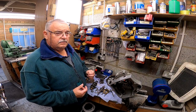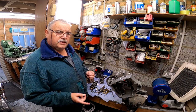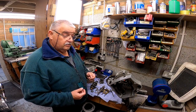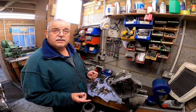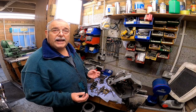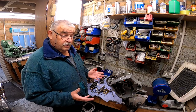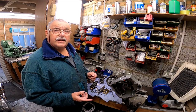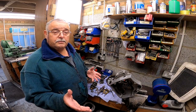This was on an old Triumph T150, that old thing behind me, and the root cause of it all in the end was the shock absorber rubbers had become swollen with oil. And you know, rubber is not compressible, it's not a gas, but it can be deformed. And if it's going to be deformed, it needs space to deform into. And when these cheap, simple pieces of rubber swell up with the effect of oil and fill all the space available, then in effect the shock absorber stops working because there's no movement possible. And that is the event which I believe triggered the failure of the gears in the gearbox. So anyway, have a look at these photographs, or skip ahead if you like.